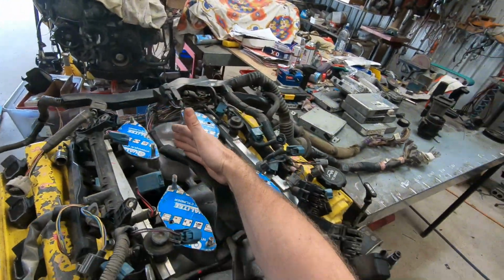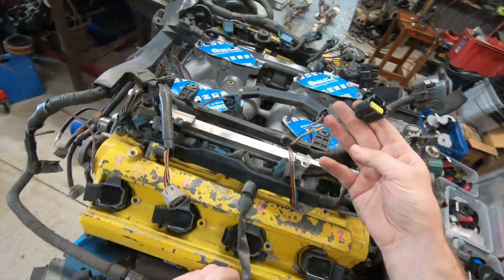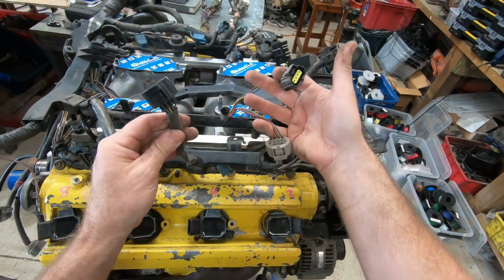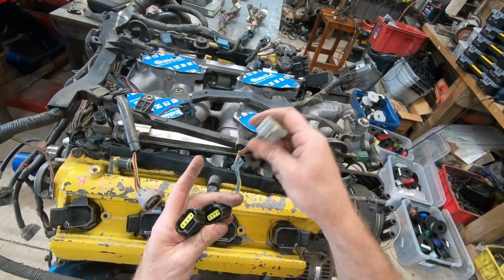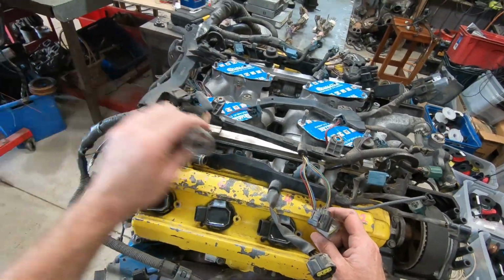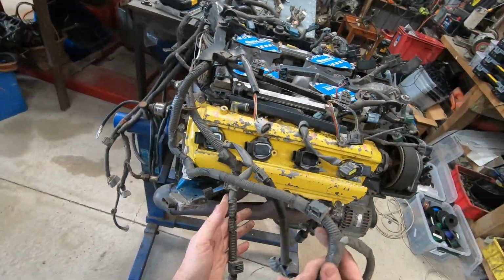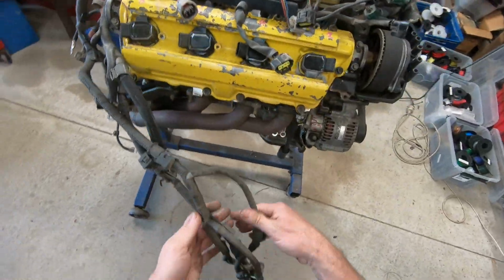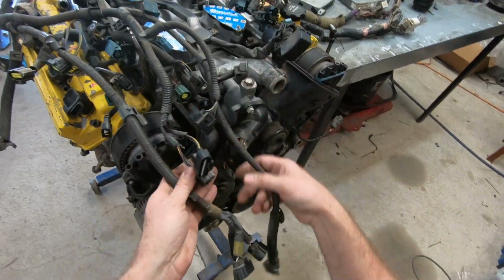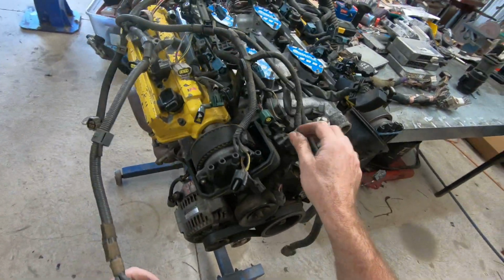And you'll see that this one has a loom through the center. Steppers, plug in, TPS. This is a traction control loom. This is non, TPS are the same. Sub TPS, well, that one doesn't have one because it's not a traction control, and this one's got a traction control wire. Now we get to some interesting stuff here. Wiring looms come around the side, over into this area here where we have the igniters. This one's got an oxygen sensor, that's the UCF20, and airflow meters.